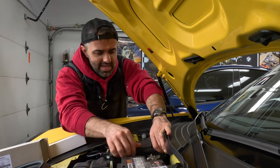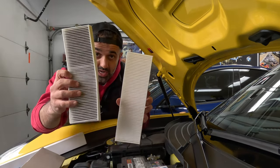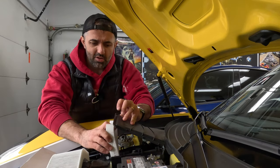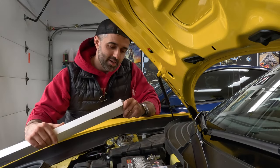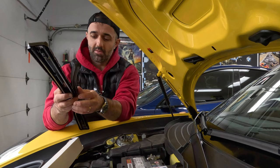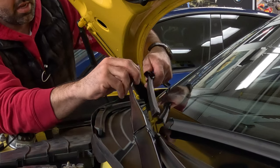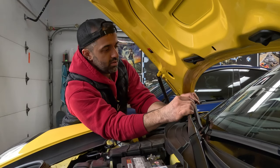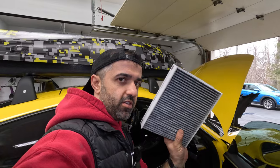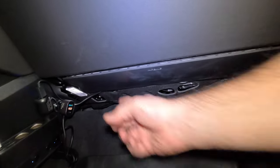Obviously I'm leaving the worst for last — the spark plugs. For now I'm going to change the cabin filter; I only have 4,000 miles on this one in a year and it got a little darker, so it's important to replace it because that's the air you're breathing. We're also going to replace the windshield wipers — press the little button, it comes out and you insert the new set. The cabin filter in the footwell: undo the plastic piece and it comes right out.